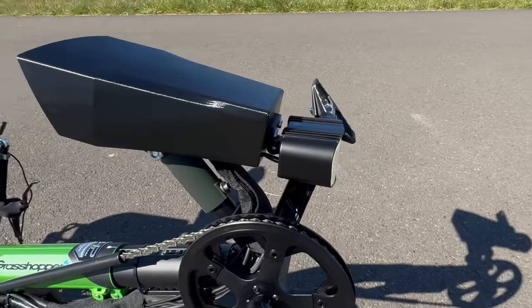Now let's move over to the other side of the display housing and talk about the lighting system, starting with the front light. This is a SateLite SPL01, powered from the bike's battery, which means I don't have to worry about charging a separate battery for the light. This thing is capable of up to 1800 lumens, which corresponds to about 30 watts. There's also a low beam mode, which is lower power and adds a cutoff to the beam, and even daytime running lights. Generally I keep it on daytime running lights and low beams at night. I also have a rear light mounted on the other end of the bike, powered by the e-bike battery, and it's always on when the e-bike is powered on. With these lights being powered directly off the battery, if the e-bike's battery ever dies mid-ride I will lose my lights, which is obviously dangerous, especially at night. The way I'm mitigating this is I configure the Cycle Analyst to cut power to the motor before the battery's low voltage cutoff point, giving me a buffer where I won't have motor power but I'll certainly be able to see. Additionally, I can use the motor as a dynamo hub just by engaging constant regen. Both of these mean that in practice I don't expect to ever lose these lights.